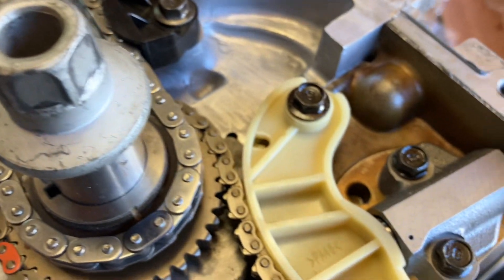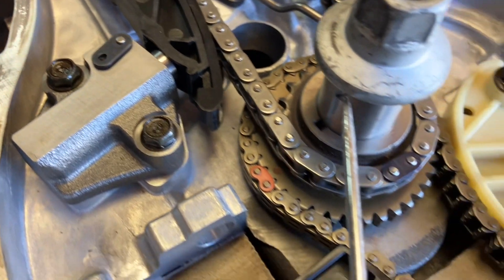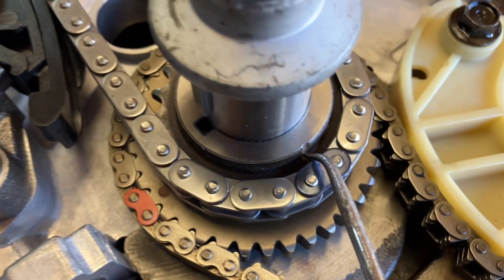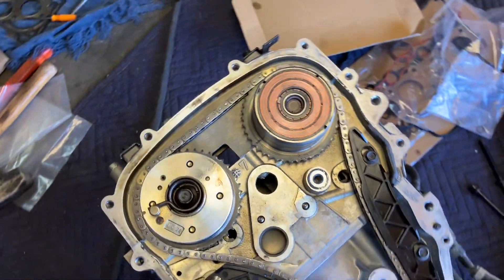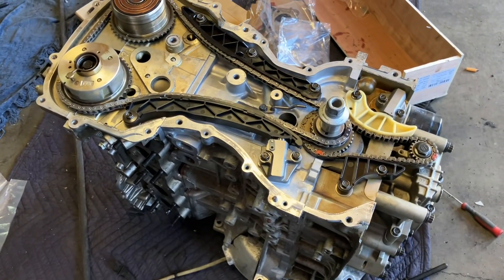And that's it — it's pretty simple. Nine o'clock keyways, time your balancer and the oil pump, six o'clock crank mark, and your cams going to the color link. That's about it folks — very easy on the 2.4 Hyundai engine. Good luck on yours.